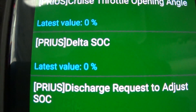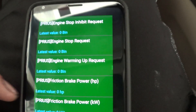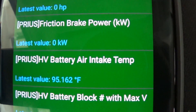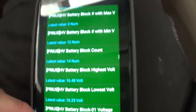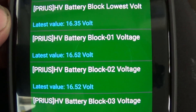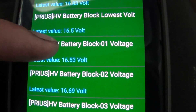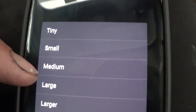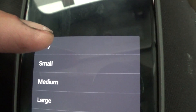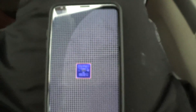One handy thing is the Prius Delta State of Charge — that's the change of the state of charge between your battery modules. Battery air intake temp is good to know. What I found most handy are these PIDs right here: the high voltage battery block numbers one, two, three, four, and so on. You just want to select — let's say — hybrid block one voltage, hit that, choose your icon. For my voltages I usually use 'Tiny' because I need to fit 14 of them in. That's how big the display is on your screen — you can easily fit 15 of these in there. But I already have all of these added so I'm going to delete this.